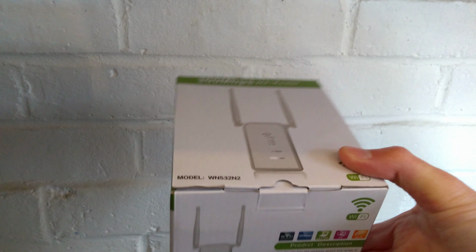And the wireless name, wireless N. Disappointingly, security mode is off by default, and it's broadcasting its Wi-Fi, and it is open as well. So by default, these things in their factory mode don't have any security. The username and password for the admin interface is just admin, and the wireless is just open as well. If you didn't notice it, the IP address it's on by default is 192.168.10.253. I'm going to give this a password.